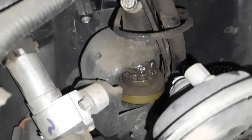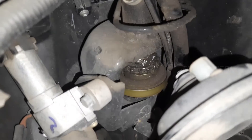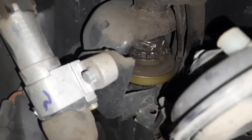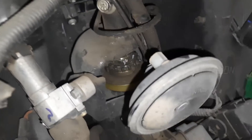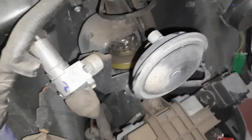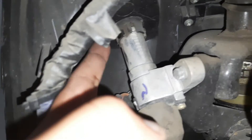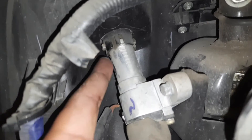This joint — many times a tuk-tuk sound comes when you turn right or left. Inside this there are bearings, so if any of the steel bearings are broken, the steering won't move as smoothly.